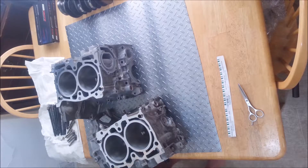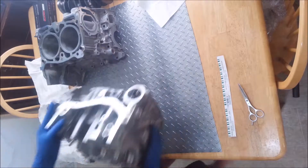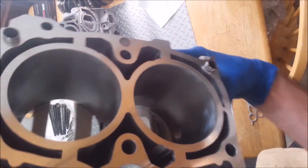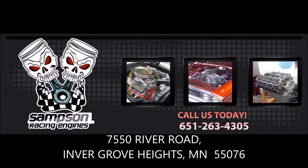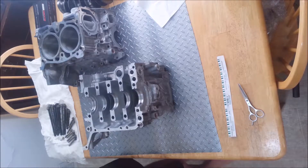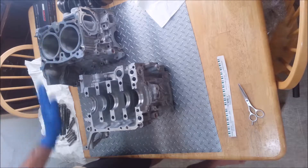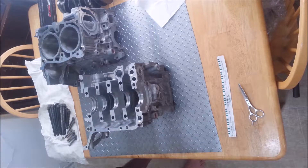I see some people put these together in a garage or outside with wind blowing around — I just cringe. Thankfully these cylinders were all within spec. I had Jake from Samson Racing resurface the deck and hone it out. He plateaued it really good. I don't like using dingle ball hones — once in a while I use them — but you want a really good plateau hone so your rings seat really nice. You should always resurface the deck too. If you're going to take this thing apart and do all this work, get the deck resurfaced so you don't run into head gasket issues, which these engines always have.